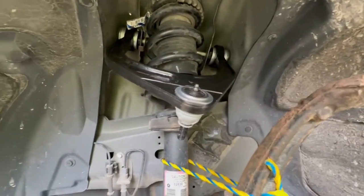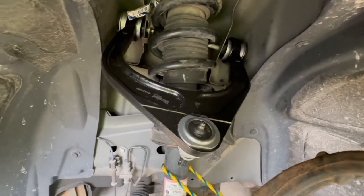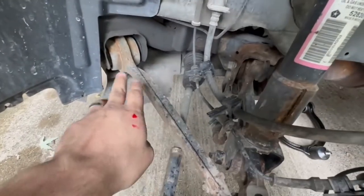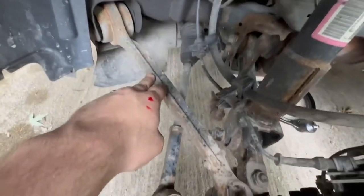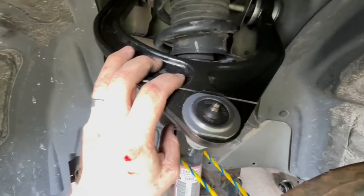So I thought that one was for the other side - it wasn't. That part that I got was for an all-wheel drive, which is completely different. With rear-wheel drive, even though this is the front, you've got two different lower control arms and one completely different upper control arm.